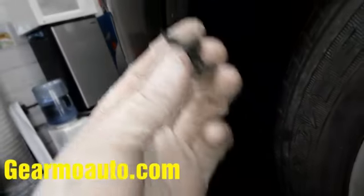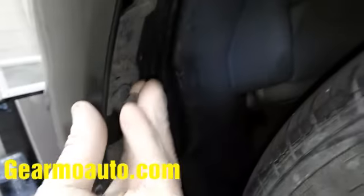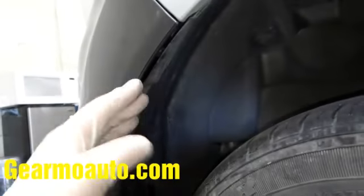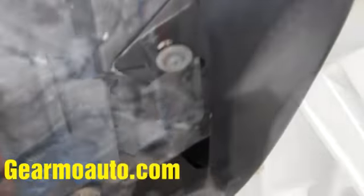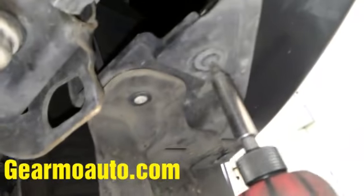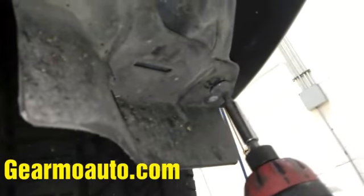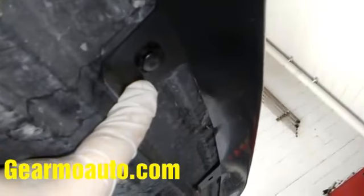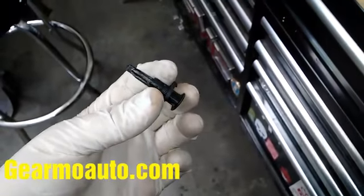Get the clips in and make sure the fender well is lined up — that's very important. Attach the fender well to the vehicle. If your clips broke, zip tie it or find another way to secure it, because if the fender well is flopping around, your wheel will likely catch it and pull it out. Now attach the bottom screws — these are important. They're seven millimeter or Phillips. Mine were missing two spots, so I used push-in clips there to secure it.